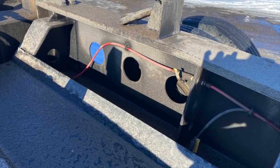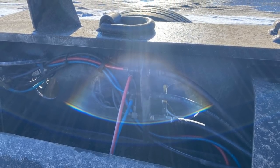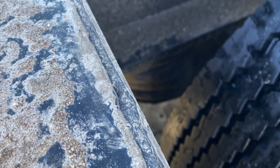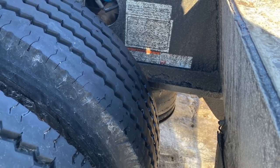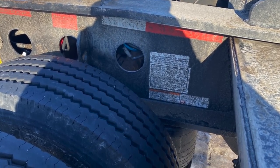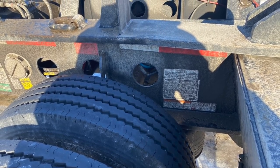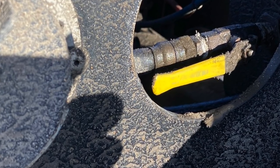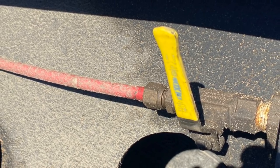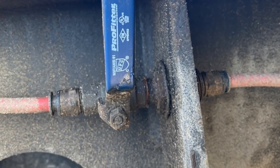Here's a closer look at the passenger side. You see there's a tap on the right side and one on the left side on the black hose. When all of them are at 90 degrees, the airbags don't inflate. When I turn one at a time — the left one or right one — they start inflating but at a different rate. This is the open position on the left side. The inscription is all faded and very hard to read. And that's the other axle.